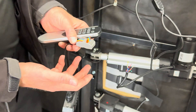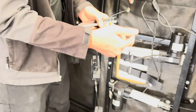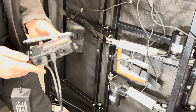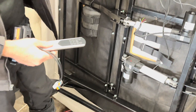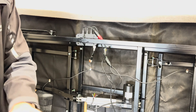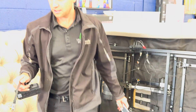Massage motors are easier because they usually only have a red and a black wire, and in most cases it doesn't matter which way they go — just slide them in and the massage will turn on. Just like that, we've converted the bed base. After everything is connected, we've included a little zip tie so you can secure it safely into the frame, and you can either take your old control box off or just leave it attached.